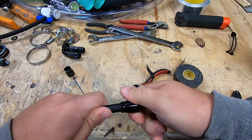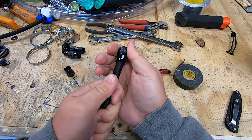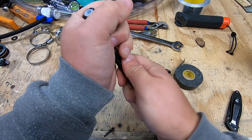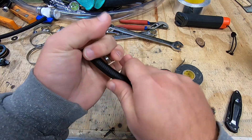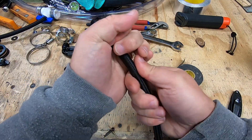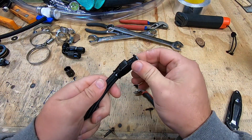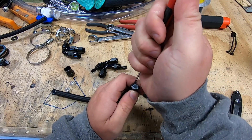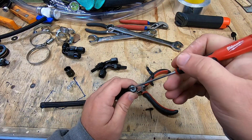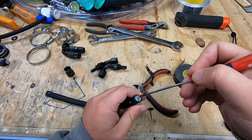I found two aspects of this process more challenging than the rest. The first is getting the first part over the braiding without jacking up or unraveling the end — and once it does go, you're greeted with some free acupuncture as the braiding begins to poke through the nut. Secondly, you almost need a third hand to get it all done; I made do with a vice. If you're doing more than a few of these, it may be worthwhile investing in some kind of vice jaws made to hold things for you.